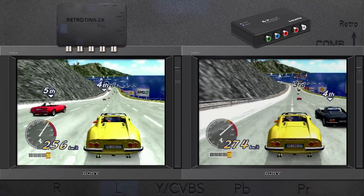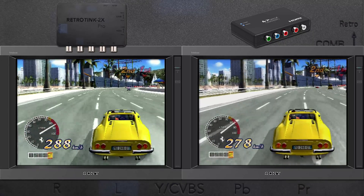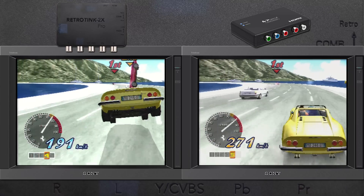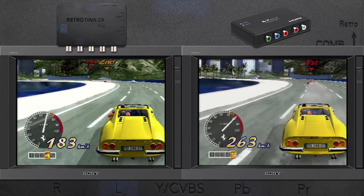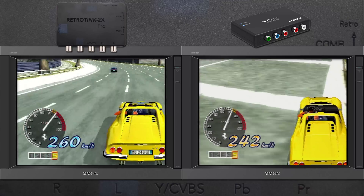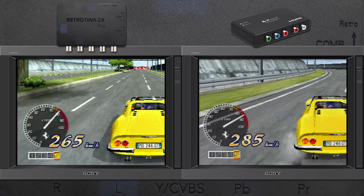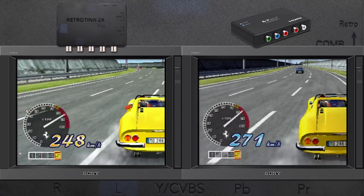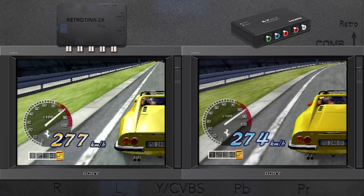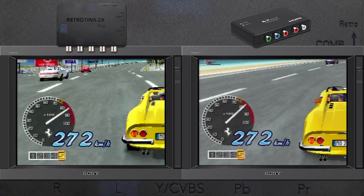One small drawback to 480p on the M, compared to more expensive solutions like the OSSC, is the internal chroma 4:2:2 subsampling of the M. That means the actual color resolution of any 480p source gets split into half horizontally. Depending on your TV's upscaling capabilities, this might cause some loss in definition on small, saturated details, and could cause color upsampling issues on vertical edges — like green outlines along blue vertical edges, which can be seen here. This is one of those things some people's eyes are really sensitive to while others won't notice at all. Even with the color compression at 480p, I think the overall feature set makes the Tink-M really worth it for the PS2, as it handles all resolutions that both the PS1 and PS2 support with zero lag added.